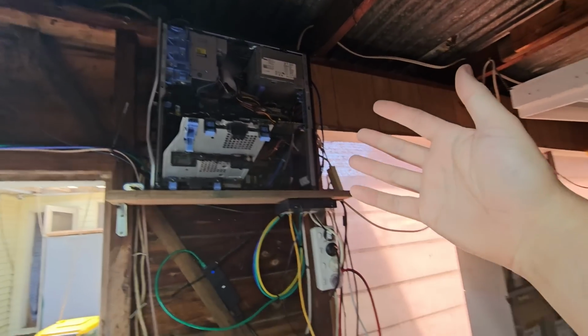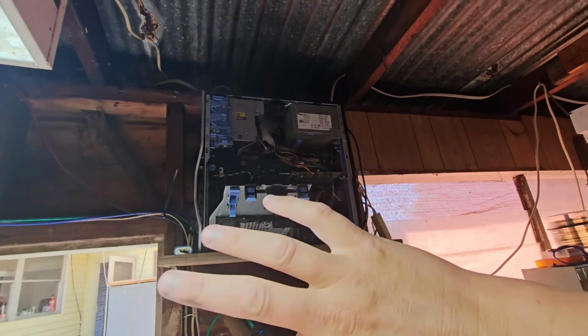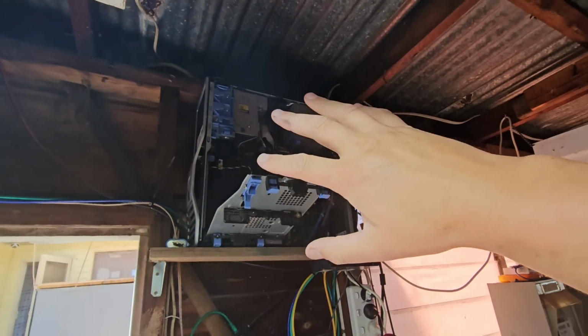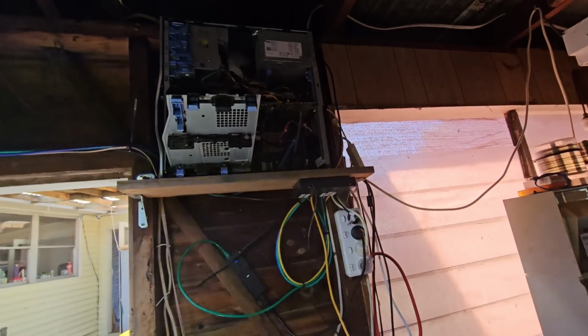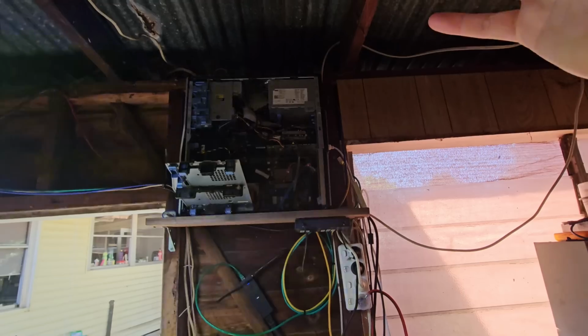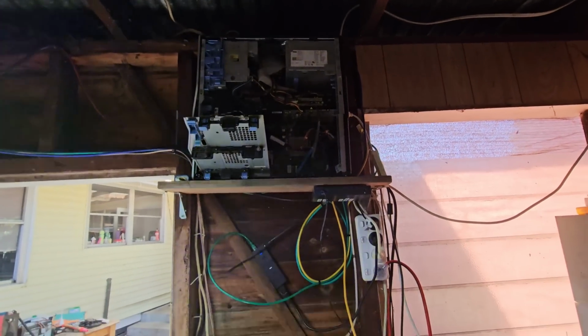I had a whole bunch of trouble cloning the SSD off. Went to use that the other day and it was just stone dead. We concluded probably power supply. This is an old Dell T3500 with a Xeon X5650 in it. Now there is another one of those at a museum I work for that's the archiving machine, so we may just raid the bits out of that and update the other one.